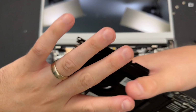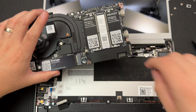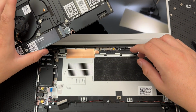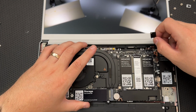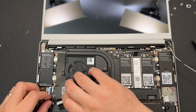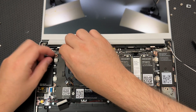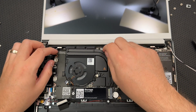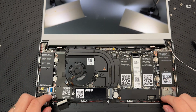Okay. The easiest way to properly install the motherboard is to align the two alignment pins in the bottom cover with the two holes in the mainboard. Alignment pins. Oh, this and that looks like. All right. So let's drop it so that that goes in there. Good. That cable needs to be not there. I think I just need to kind of do a little wigulation here. Wigulation, I suppose. To get this in place.